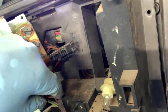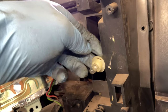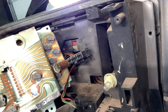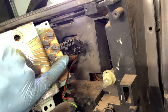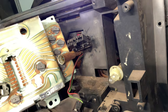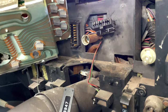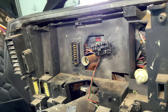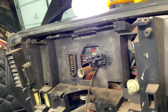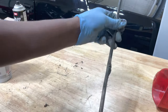There's also this thing that clips in right here — held in with a 6 millimeter as well. You've got your check engine light bulb here too. After you do all of that, there's a clip where you have to come from the bottom with a pick tool and push it up to release it. There's also a ribbon cable that pops off easily. So you have to contend with those five things to take it off. Now I can show you that fray a little bit better.